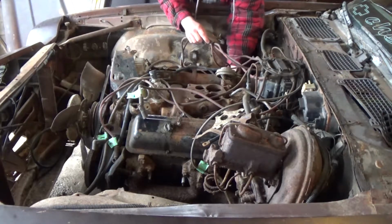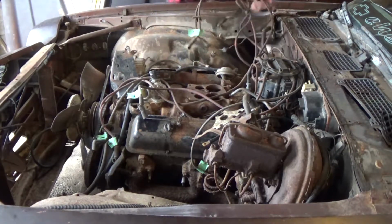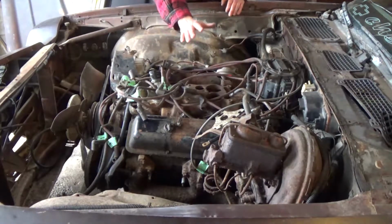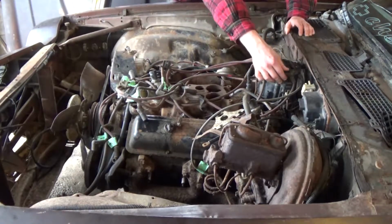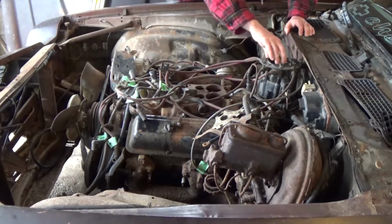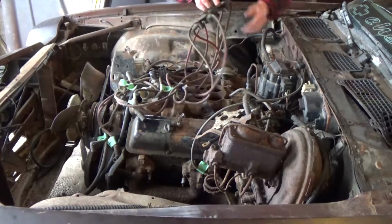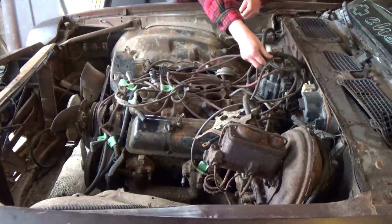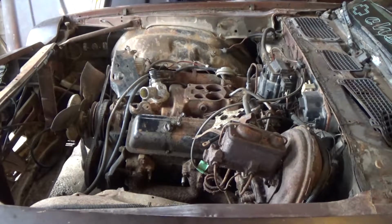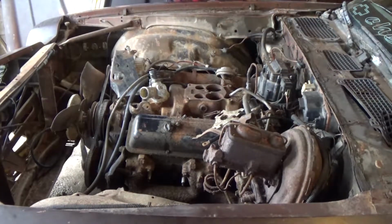We'll pull off the number 8, number 6. Try not to take the old dipstick out with us. So, see, they're just a mess. So, spoiler, we are replacing the plug wires, but that's pretty self-explanatory why. One thing I do like about this cap is everything stays in order, and there is one that's not meant for that, which is the number 5 plug. So I know there's going to be a hole there, so I know that matches up like that. So we can take these right out of the equation, and we don't have to worry about mixing them up. Number 5.